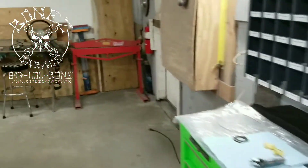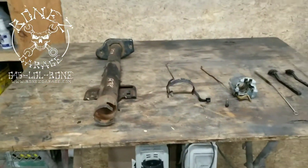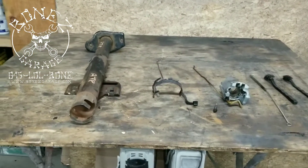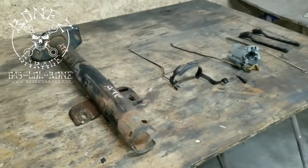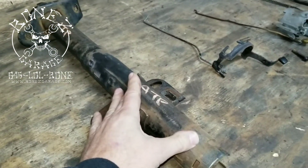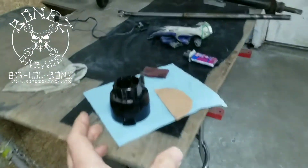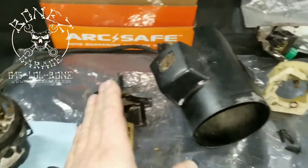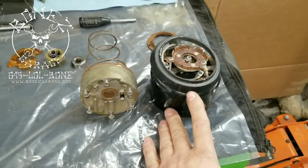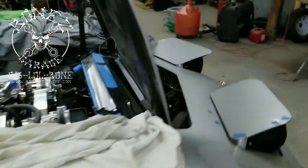There is a lot of stuff in there — it is extremely complicated and extremely fragile. You have to be very careful taking these apart and putting them back together. The reason we took it all apart is we're going to rebuild everything and make it all like brand new. The lower half of the column is going to be powder coated satin black, and then all these other pieces will be a flat red to match the interior color.